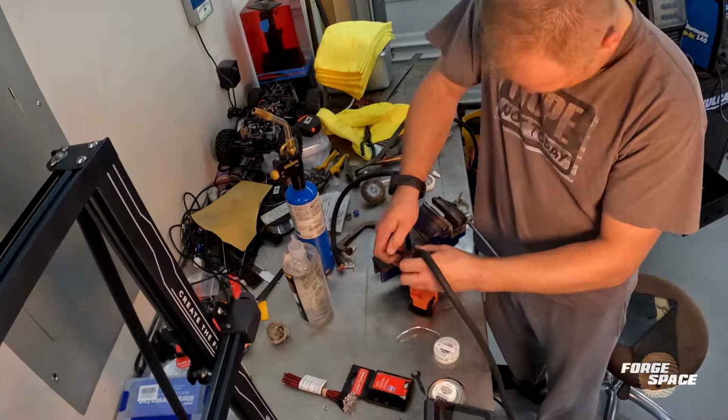Centerpiece glued in to hold this spaced out as needed. I'm going to go ahead and put a metal flashing tape across this bridge, this gap right here. And then I'm going to make a mold, basically do a bridge where it's overlapping this about 1.25 inches all the way down. That way we can put a lip on the inside here, from here to here, that is going to support the front when it closes.